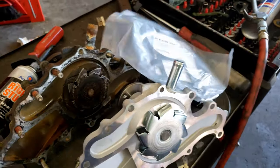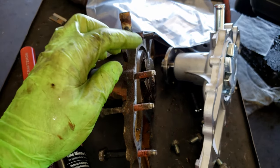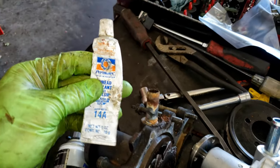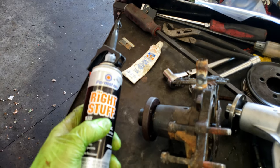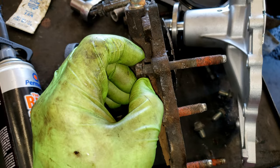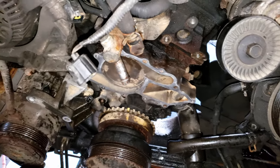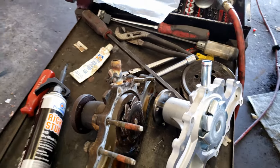We're ready to put the new pump and gasket on. Most important step: see how these bolts have thread sealant on them? You want to wire-wheel each bolt clean and then use new thread sealant. You can use Permatex thread sealant with Teflon, Teflon tape, or what I really recommend — covering them with the Right Stuff. Those holes in the block lead into coolant passages, so if you don't do this you might end up with coolant trickling past the bolt head. Most of them aren't blind holes — they go into the block — so I put sealant on every bolt just to be safe.